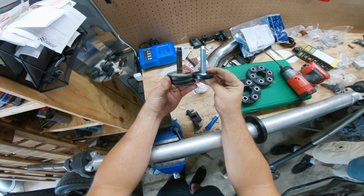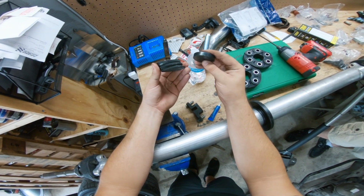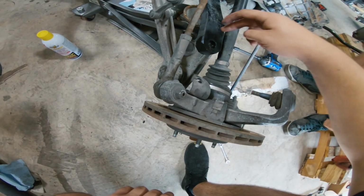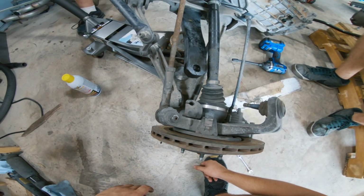You notice this one right here on the right, they're the same height threads, but if you notice there's like 3/4 of an inch difference right there, and that's actually what lowers the car down. You guys can go check those out in the link in the description. So yeah, check it out. They basically slide into this big monoleaf, and you can see that spot down there on the lower control arm where it's been resting. That's pretty much what controls the height in the back.